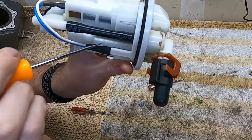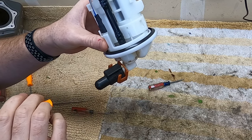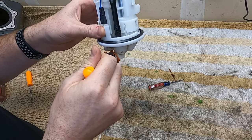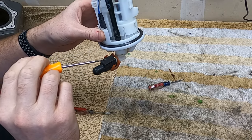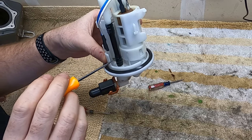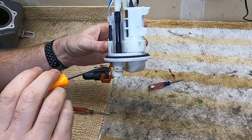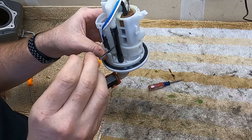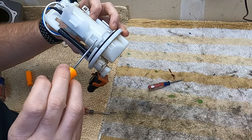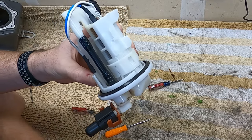You can kind of access the third clip by lifting up right here. This fuel line here does not want to come off — it's a very thick, heavy duty line. You can replace it; there are kits you can buy on eBay for new filters and lines, so you can just cut the line to make this an easier job. But I was trying to keep it all intact. I found if you start on the hardest one first, then the second, then the third since it's the easiest, you can get it done. So bear with me while we make this happen.